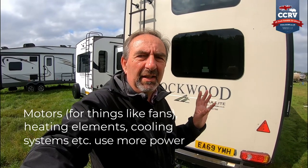We're putting two panels on this, a couple of batteries, combined with an MPPT controller and an inverter. On 12 volt: the water pump works, the igniters for the hot water and the blown warm air central heating will work, and 12 volt lighting will work. For the TV you'll need an inverter - TVs run all day, they don't burn a lot. A microwave will be no problem too. They won't run electrical heating systems and won't really run air conditioning. So bearing in mind you're living off-grid, you've got to be sensible with the cost of the system and how many batteries you put on.